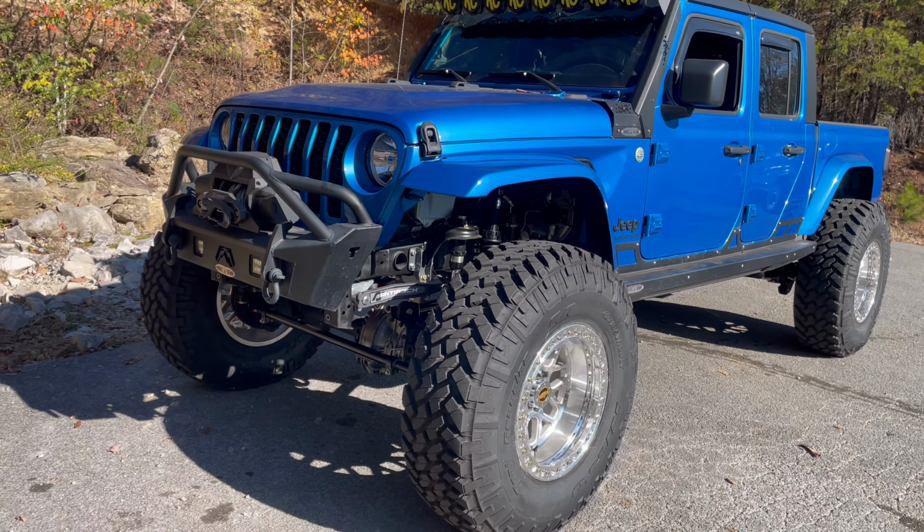And again, he's gonna be doing the inner fenders once he gets home, as well as that fender bracket to stiffen up the structure of that factory outer fender. You can see here, this thing really does twist up, and we've got the clearances dialed in. He's got 4 inches of bump stop to add on the front to correct that in the front, and then on the rear, he still has a small amount of up travel left on the shock, but at full bump, the tire barely contacts this fender, so should work out just fine. And yeah, it's an awesome rig. We thank him for bringing it to us.